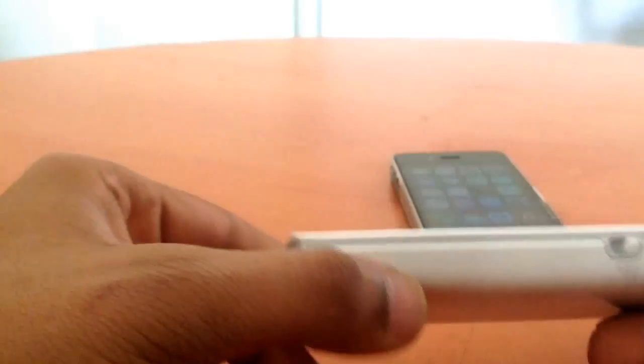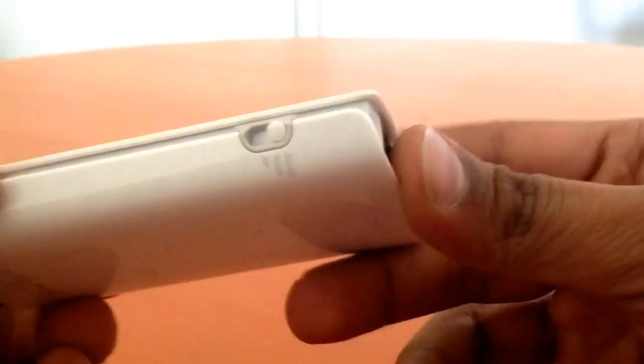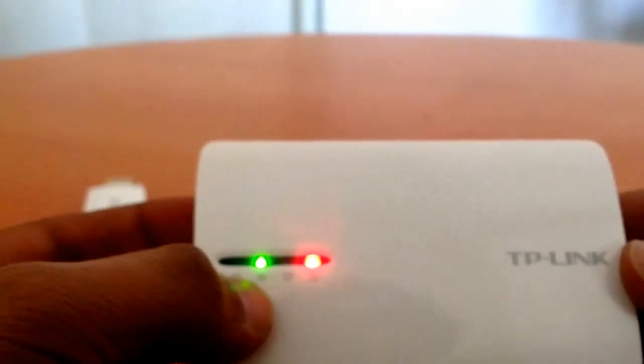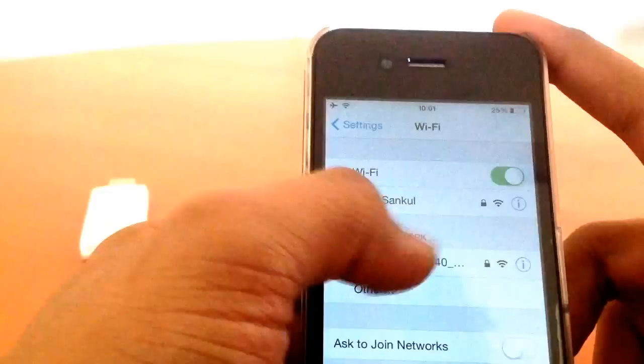Now you have the TP-Link router. Switch on your router and it will power on. Wait for the Wi-Fi symbol LED to activate. The router has a few modes — 3G/4G mode, WISP, and access point mode. We are going to focus on 3G/4G mode, and the default setting is already on 3G/4G so we'll leave that as is. Once the Wi-Fi symbol is on, search and scan for Wi-Fi. Go to your settings, then Wi-Fi, and you'll see the TP-Link MR3040 listed on your device.